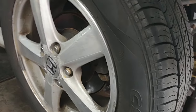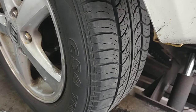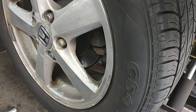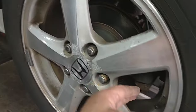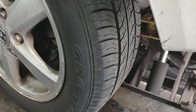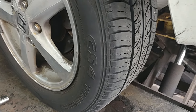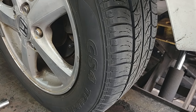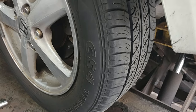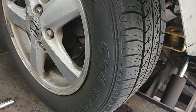If you see high and low tread on your tire, this is where the noise is coming from most of the time. Of course you have to check the bearing, the brake rotors, the brakes, the differential — they all make noise — but usually tire noise is a pulsating noise. It's not consistent; as you go faster it gets louder, but it's pulsating, like up and down, up and down.